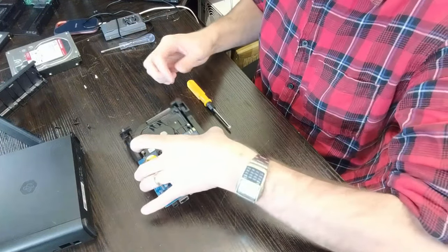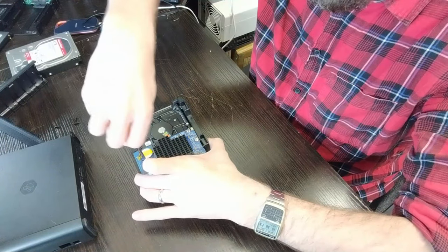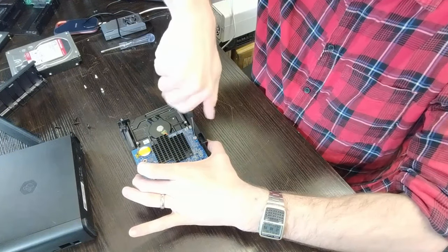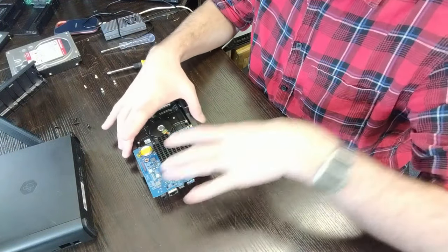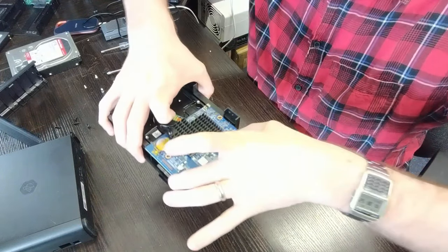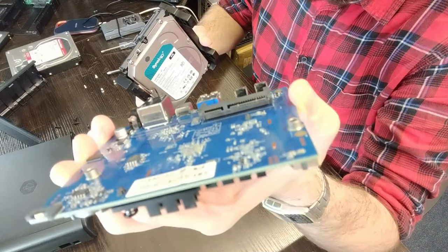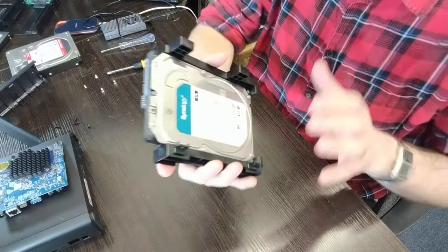The next thing to do is remove the drive and backboard. On the back there are two additional silver screws which are removed very easily; this allows you to slide away the main controller board of the system. This is when you have to be insanely careful — you could potentially scratch the main PCB completely, destroying your system. There is a SATA connector underneath which you really do not want to break — it's very delicate. Slide the drive away from the PCB or the PCB away from the drive, then double check the SATA connector is undamaged.